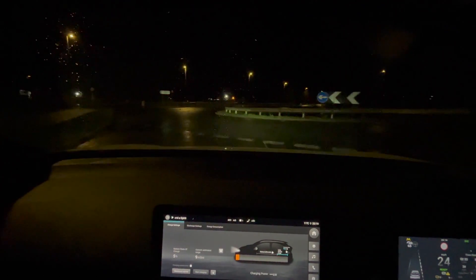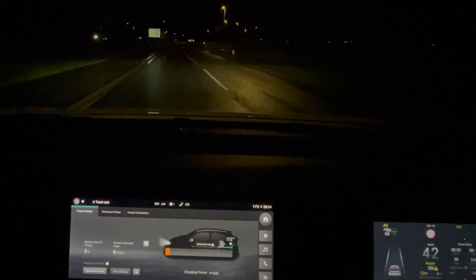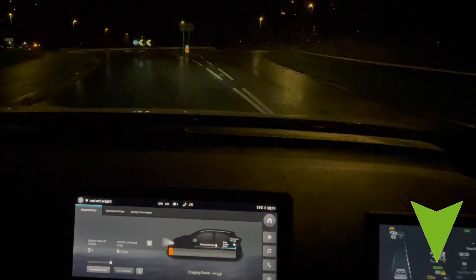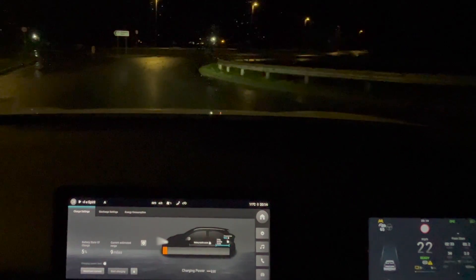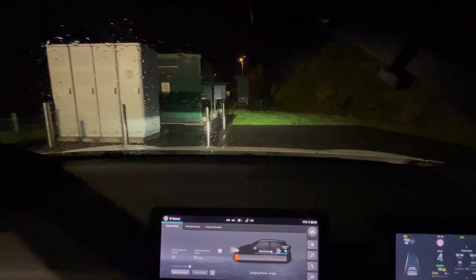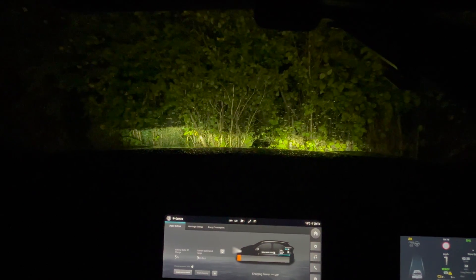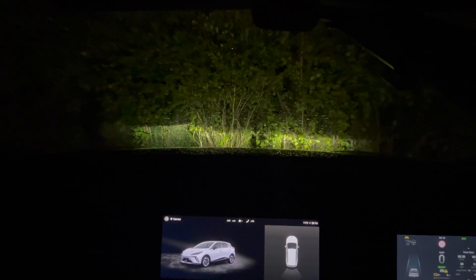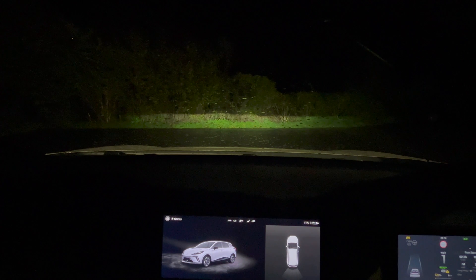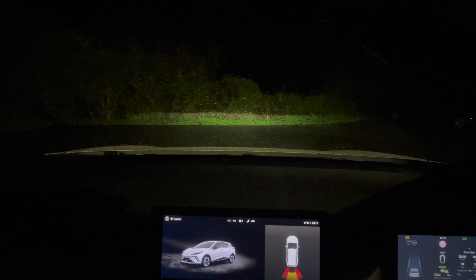It was a very wet and windy day so we didn't fancy going much further below that. As you can see on the driver's binnacle we've got the warning signs up asking us to charge the car. It did ask me to reduce the power, but I selected no because I wanted to use as much power as I could before I got to the charger. One other thing I also tried was a bit of what's called yo-yoing — that's constantly foot down, foot off the accelerator. Anything to try and gain as much temperature in that battery pack. It's 11 degrees outside so we want the best possible chance to get this peak speed.